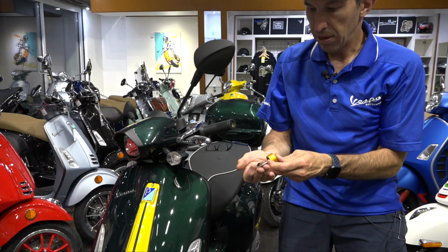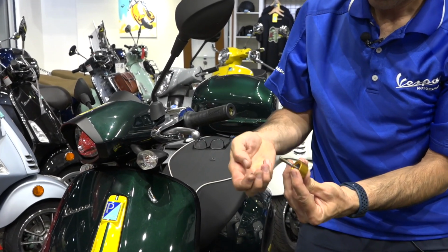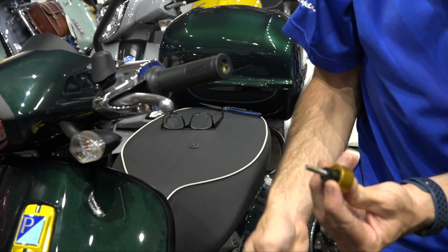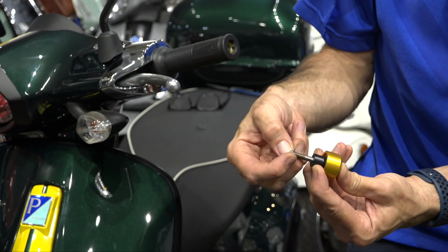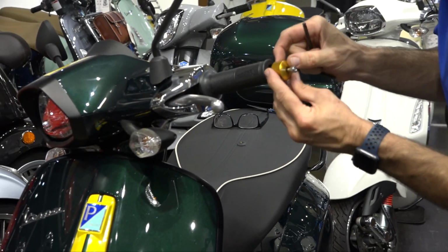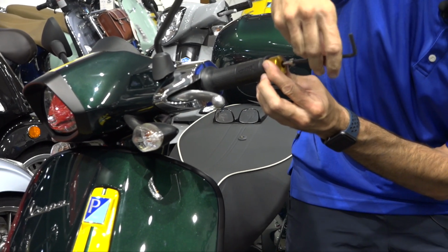Next, there's this pair of plastic washers. Go ahead and drop that on. Then drop that spacer you just cut. It cuts really cleanly, no problems there. Drop that on. And last, you'll take this star washer, that's a locking washer, and put that on that part. At this point, we can get it all lined up. There is a Rizoma writing on it, so make sure you get that oriented just the way you like it.